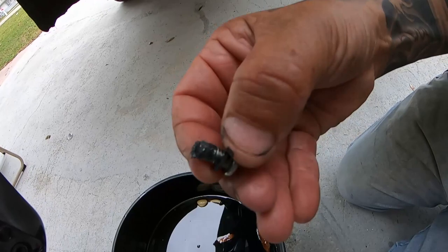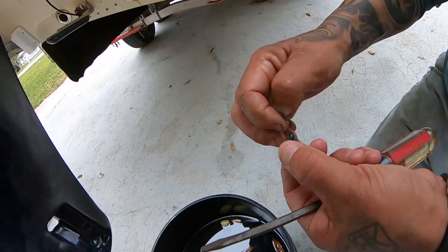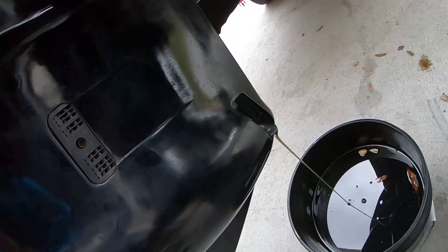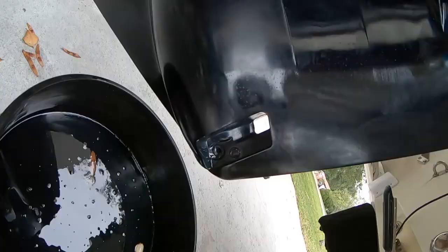That's acceptable - absolutely. See how it's real fine like hair? That's great. If you pull it off and can feel chunks - bad. But fine particles are absolutely nothing wrong with that - that's fantastic. Drain it out - a little metallic look to it but nice and clear. It is beautiful. It does smell though - that HD lube is stanky.